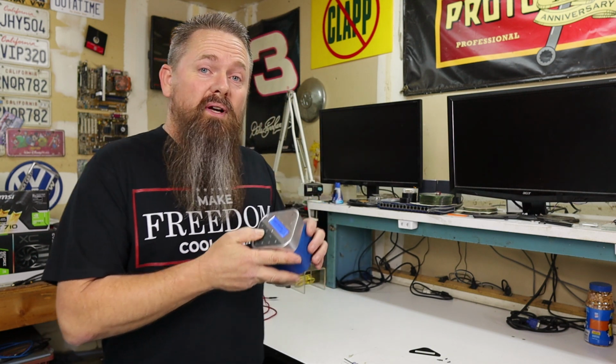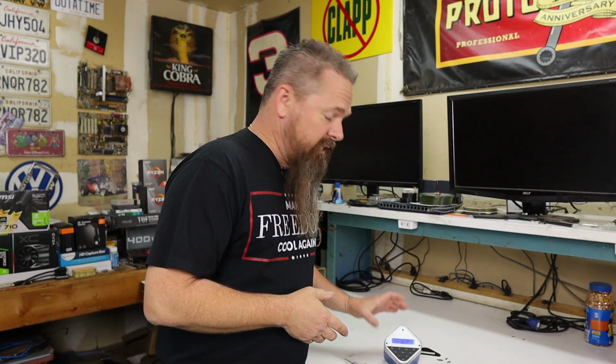Better stop this before I get a takedown notice from YouTube. So anyway, that's what it takes to hack the Joel Osteen Inspiration Cube. You can put as much audio on it as you want as long as you follow the naming convention that's on the original SD card. The different folders need to have all of their MP3s in order based on that naming convention, and everything should work fine for you.